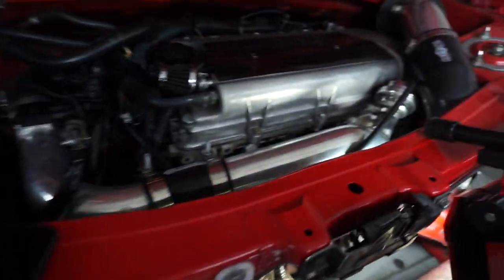To make this easier, we're gonna remove the intake side of the turbo and then move the charge pipe side and set it aside. We'll leave the turbo in there but have a nice clean workspace. There's a lot of drippy oil down there. Let's go ahead and remove the charge pipes — it's not hard to remove.